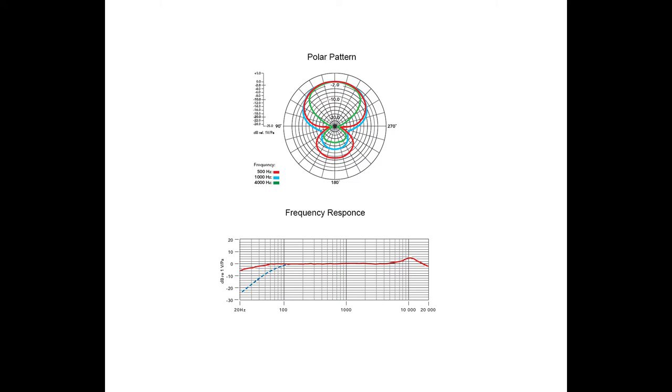In addition to the microphone's native 40 Hz to 20 kHz response, a selectable high-pass filter at 80 Hz is available, which will prevent low-end noise such as air conditioners and traffic from being recorded. A -10 dB and -20 dB level attenuation or pad, selectable from inside the battery compartment, allows recording of loud sound sources such as live music or motorsport.